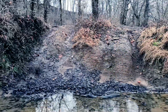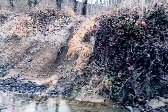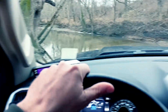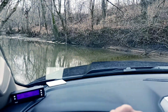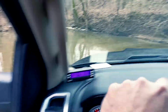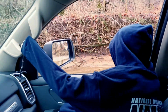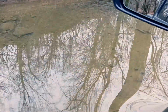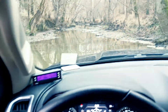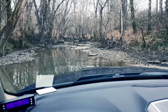Yeah, these hills are a little bit too soupy today. Too steep of an angle. This truck doesn't have the proper approach angle for something like that. That's where the Jeep shines. But if nothing else, it'll give us a chance to work the transfer case a little bit. Never hurts to put these things in low range once a month or so, keep everything from freezing up.